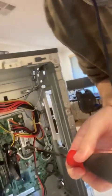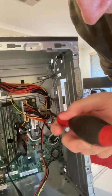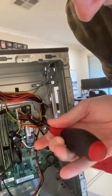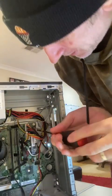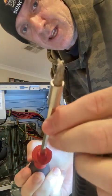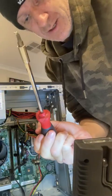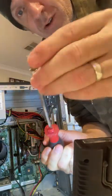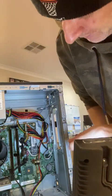I'll just bring the camera in — that's the SSD there. There's one little screw at the top here. I'll take that out now. It's just a tiny little screw. Do not lose that one, because the SSD that you get does not come with a screw — this one I got doesn't — so do not lose that.